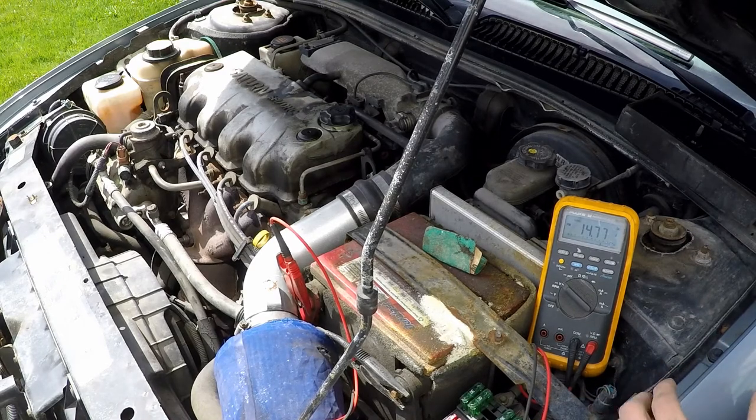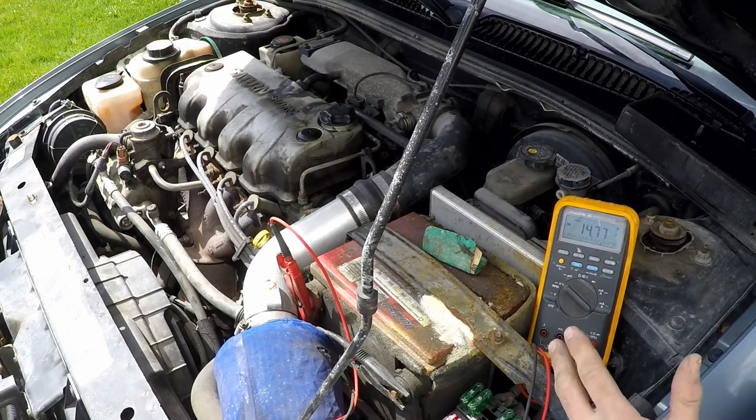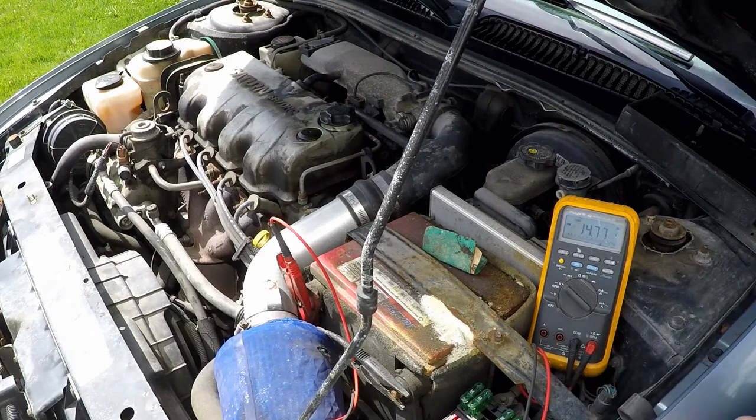My engine is just simply running, it's using the fuel pump, it's using the injectors, it's using the ignition system, and it's using a couple of relays to operate different electrical components. So it's pretty minimal. It's running pretty lean right now without a lot of components sucking power and requiring extra juice. But as we add individual loads against this, that'll really tell us the health of our alternator. That alternator should be producing relatively high voltage right now because it's charging the battery back up after we've started it, and then it should kind of even out over time.